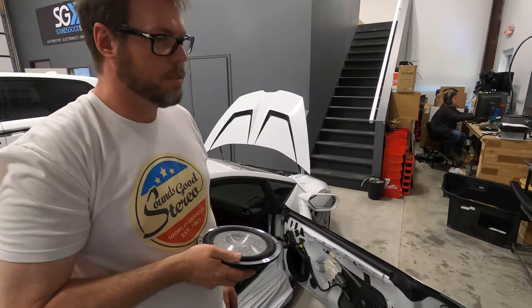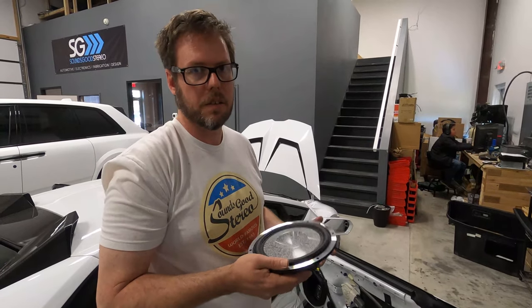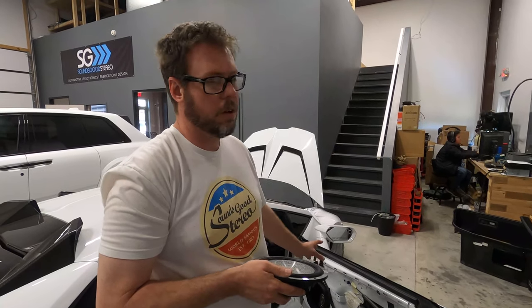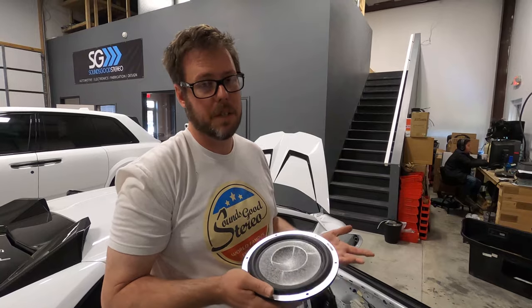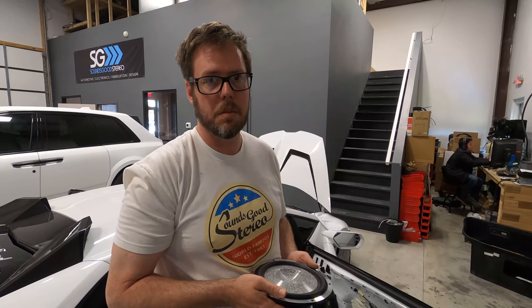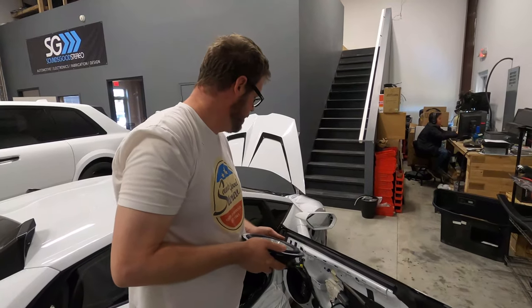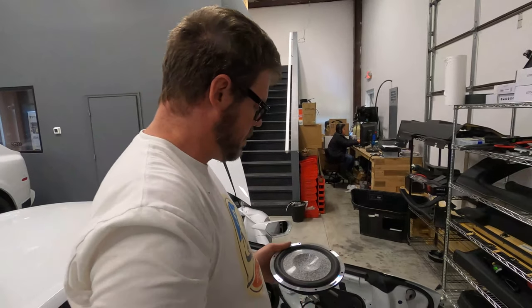Stacked together in three pieces, it's very rigid and dead, so it works properly. To put together HDPE, it would all have to be screwed together with silicone because you really can't glue HDPE. HDPE is actually what super glue bottles are made out of, so nothing really sticks to it. That's what's going on here.